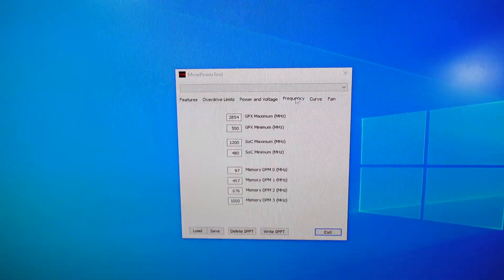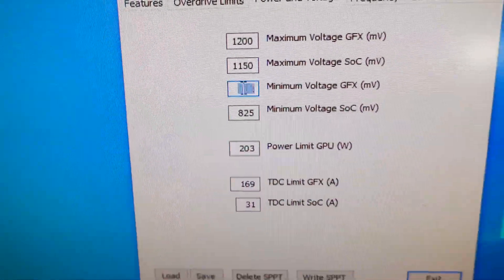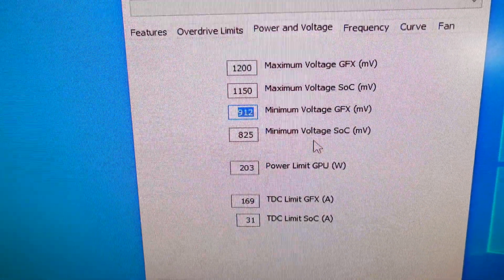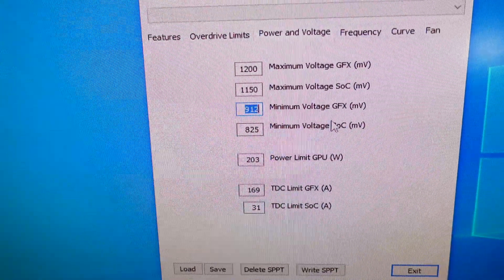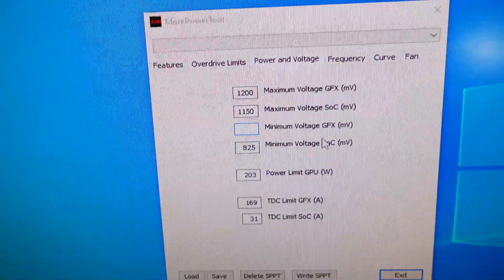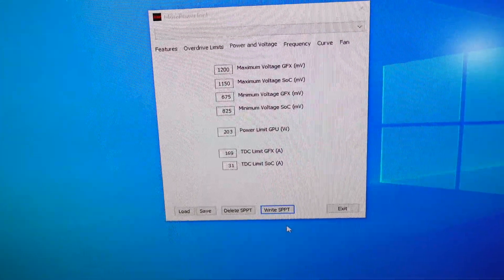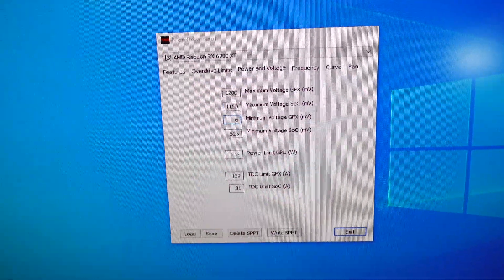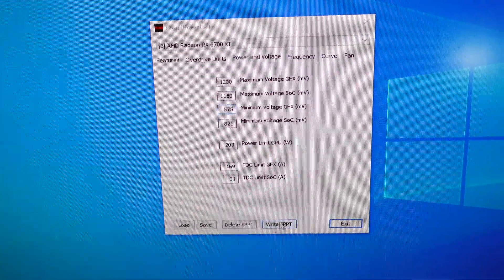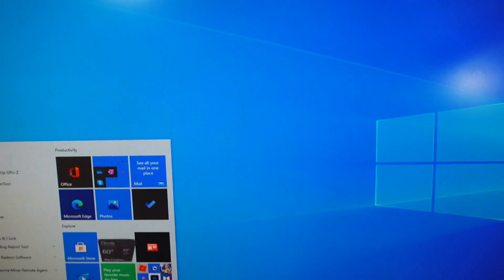I don't know everything about this tool — there's a lot in here. What we are going to worry about is power and voltage. Here you can see that 912 that was our limit. Instead, we're going to reduce that more so that AMD's Radeon Software lets us go below 912. I'm going to go down to 675. Hit Write Soft Power Play Table — make sure you pick the GPU first. 675, hit Write Soft Power Play Table — got 'successfully added'. Exit this, and to make it stick you gotta hit Restart.